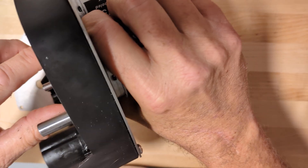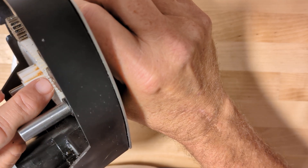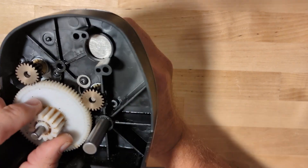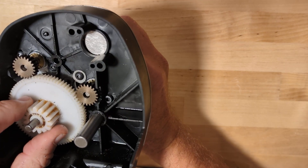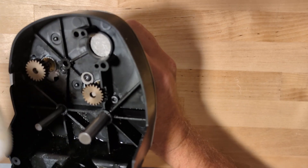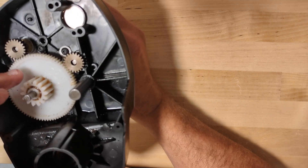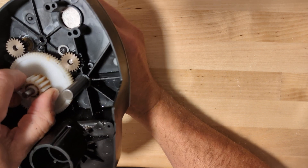How much you engage matters — if you set the gear deeper on, you're getting less friction but less endurance and durability. Like everything in racing, the closer to the edge you get it, the faster you'll be, but the more chance you'll blow up. You can use this kit with just one motor — some racing arenas only use a one motor first gear delete and that's fine. We've actually been told by most guys they're getting more durability out of the gear with two motors on, and that makes sense because it's sharing the torque load across the gear and making it a little easier on it.